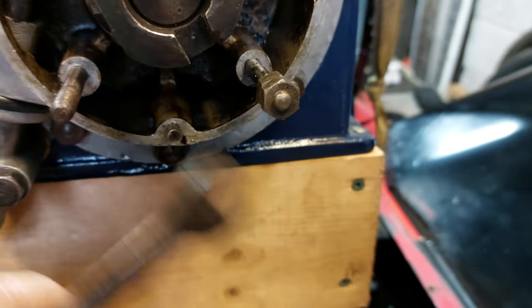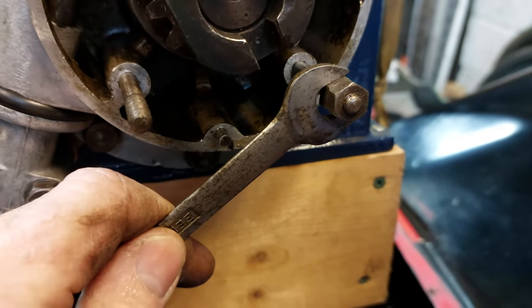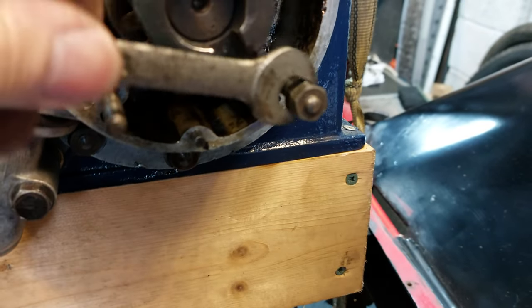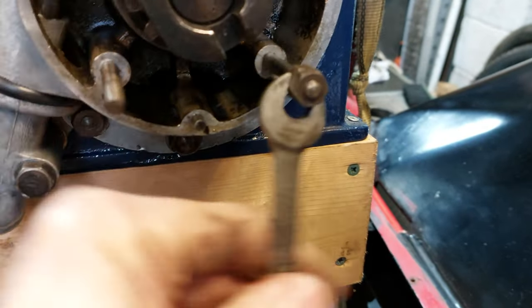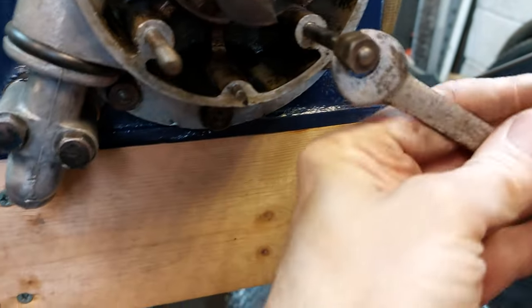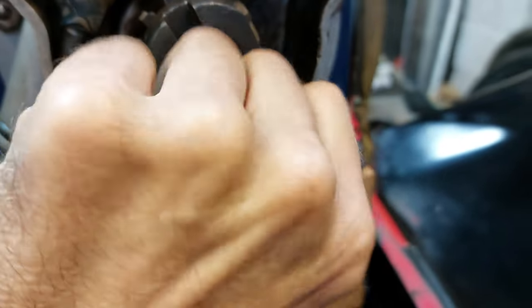So you tighten this nut against this nut with two spanners, and then you put the spanner on the lower nut, and it should, nine times out of ten, bring the stud out with it. Sometimes they are really tight and this method won't work, but normally it gets you out of the spot. Especially as my stud extractor's a metric, so no help at all on this.